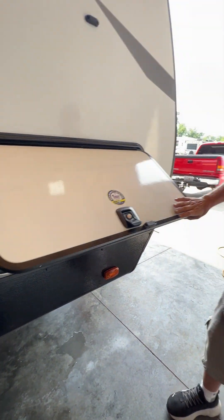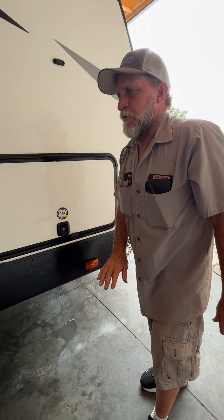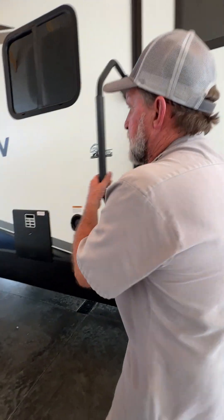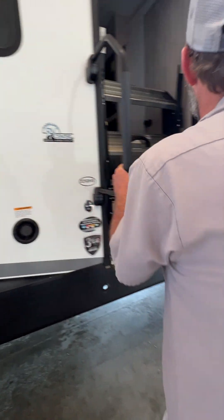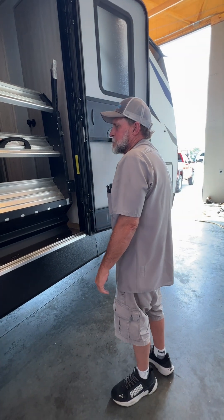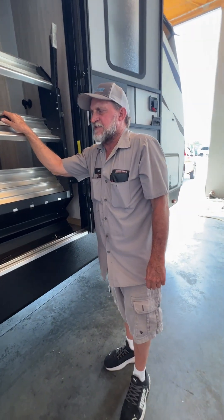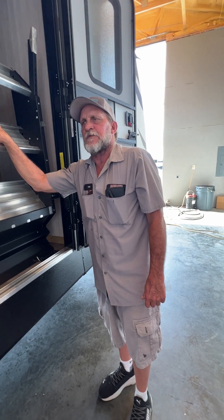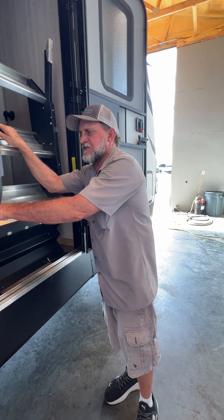That's basically it on the outside of your unit. One more thing I want to mention about the unit: the life of the trailer is the roof. Anything that happens to the roof up on top will start showing on the four corners inside or out. So every 90 days I suggest going up and checking the roof. You don't have to seal it every 90 days, but at least keep a close eye on it because the roof is the life expectancy of the trailer.